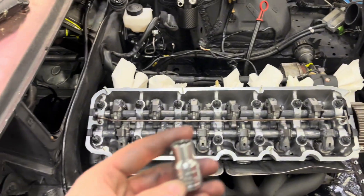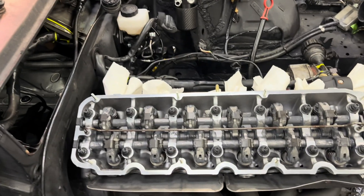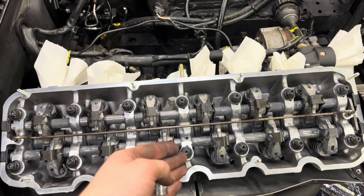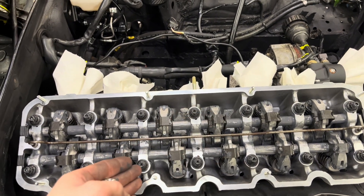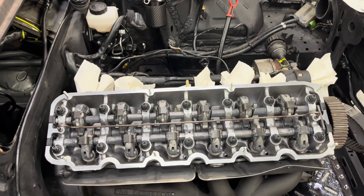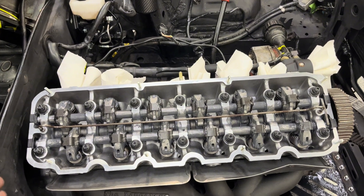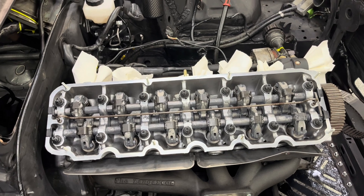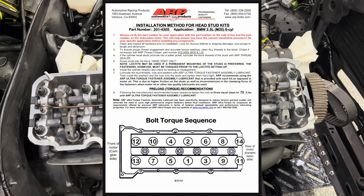The socket you're going to want to use is a 12mm socket. The torque procedure: you're going to start in the middle — that's one, two, then go to three, four, five, six — in a star pattern. Starting at one, you're going to do 23 foot-pounds through the whole sequence. Then adjust the torque wrench to 46 foot-pounds and do them all again in the same order. Then move to 70 foot-pounds. I'll put the instructions and chart up on screen to show the full sequence.